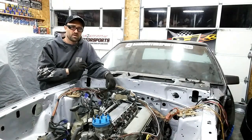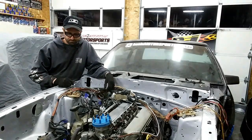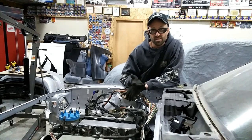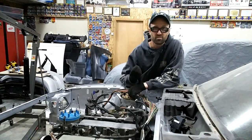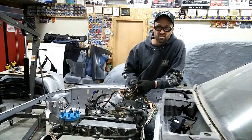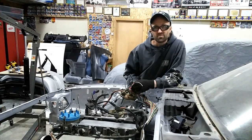Everything will come out here. I'll either come out the side where the grommet is — where the radio connector was, since I'm not going to run an antenna on this car — or there's also one on the driver's side. I don't have emissions in my county so I don't need to worry about having a smog pump, the EGR, or a lot of the vacuum lines that were needed on the '92, since this chassis is an '80. Really all I need is the two O2 sensors to feed the ECM, and most of the emissions-related stuff can be taken out.